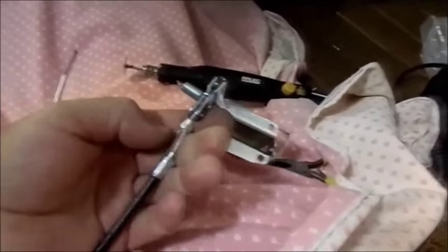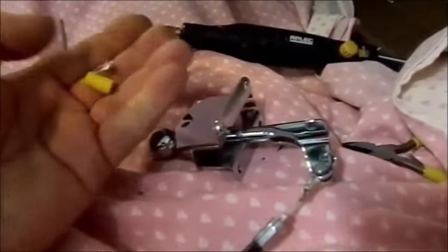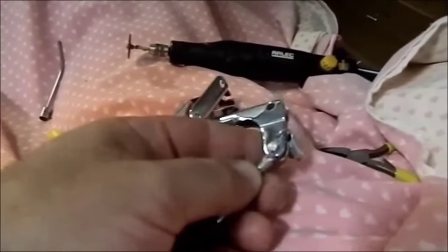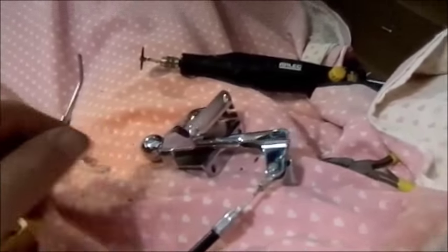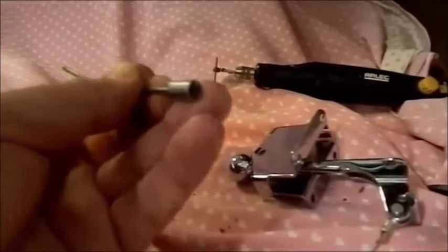Boot release saga — I've just looped the cable over that pin. I've taken that fitting out. I've just got an old electrical terminal — well it's a new one — and cut off the crimp section, and crimped that on there. I'll solder that now. Hopefully that remains effective. When you're cutting this sort of cable with a Dremel, it leaves little bits and pieces, so just go around with a magnet and pick them up so none of it sticks in your carpet, because if it sticks in your carpet it's hard to get out.